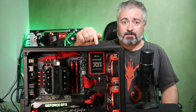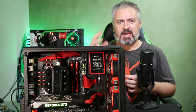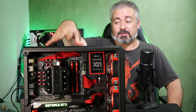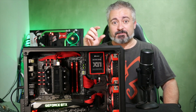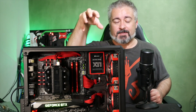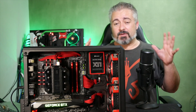It is not the only drive out there that can do that — there are plenty of very fast SSDs out there. The thing I like about the Corsair one, and the thing that I think makes it worth the money, is all the other technology on there. Double the cache, which means it's going to be able to keep up with itself under massive loads — much better for things like 4K video editing as your scratch drive. It has power-off protection, which I love. If you lose power and you've got something sitting in your SSD cache that hasn't been written to the actual memory yet, it's gone forever as soon as the power drops — that won't happen with this. If the power drops, it has enough internal power to recognise what's happened and write the data across to permanent storage, saving you. If you're building a high-end gaming rig and you want everything to be the best it can possibly be, I think that is an absolute choice.